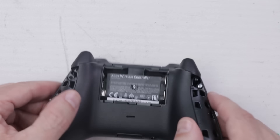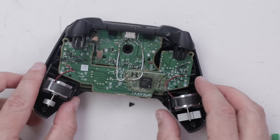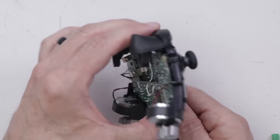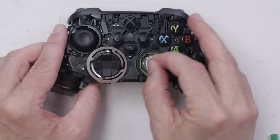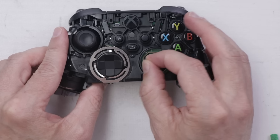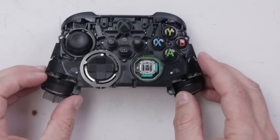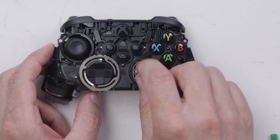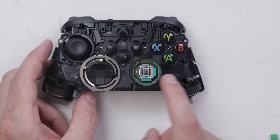Let's see if this one has the same problem as number two. It looks like we got the same problem — that piece has been broken out of the inside of this thumbstick. But let's check how the analog stick mounted on the board is. Actually, this one looks and feels really good — I don't see any cracked or broken pieces, so I think this analog stick is fine. This one just needs a new thumbstick cap. Once I get a replacement, it's just a matter of plugging it in and putting it back together.